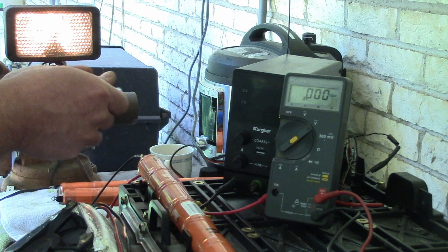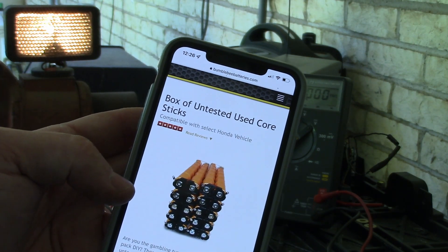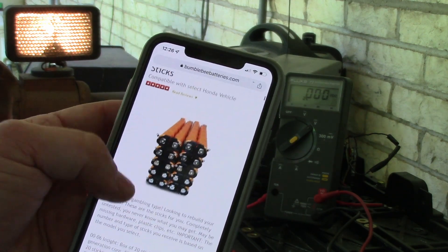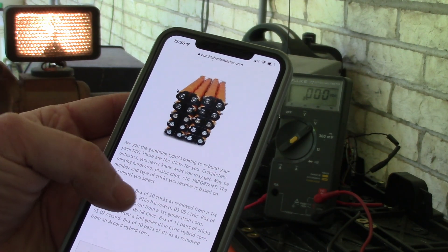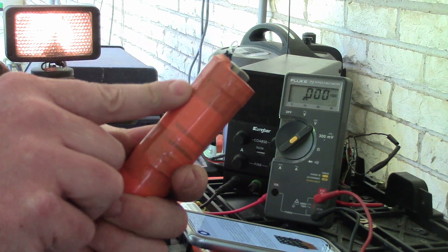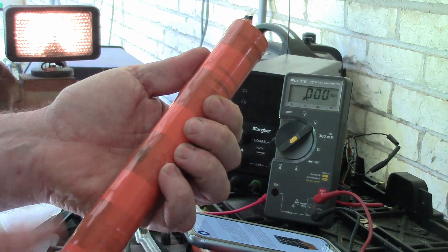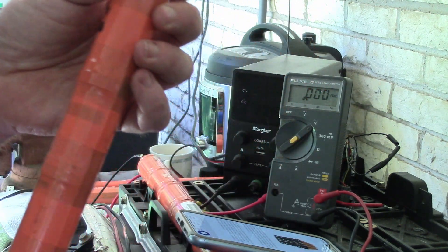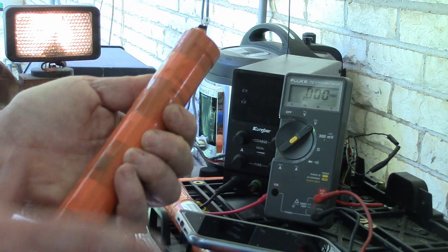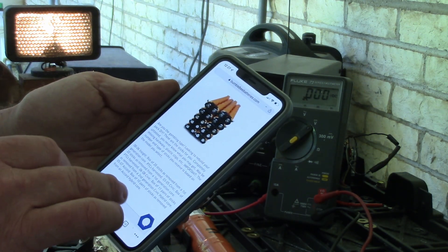Now what I've gone and done, since I'm going to do stick-level maintenance, I've ordered from Bumblebee Batteries a box of untested used core sticks. They say that you get 20 of them — they're untested, right out of someone else's bad battery pack. They do cut them open and remove the PTC strip. The PTC strip is part of the Insight's temperature monitoring when you're using the battery. Each one of these strips is like one ohm or something, and it checks to see how far the resistance of all these strips combined differs from one ohm to get an idea of if the battery's hot or not. They take the strips because they put new batteries in battery packs. So when you get their batteries, you need to remove your strips and heat shrink it onto whatever batteries you determine are good. So $200 for 20 batteries — 10 bucks a battery — plus shipping, about $50 or $60 for my state at least.